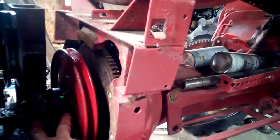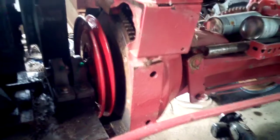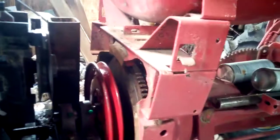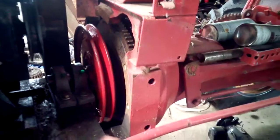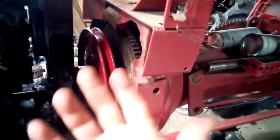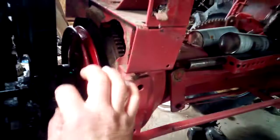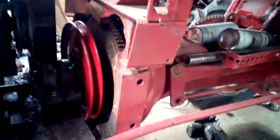Of course, two pillow block bearings, custom machined hub, so the flywheel sits on it, and then it has a shaft, so it still allows the pilot bearing and the clutch and everything to mount. The only thing that's really had to be machined is basically that hub that allows the flywheel to kind of cup around it like it would on the crankshaft of the other engine, and bolts on with 4 bolts with a shoulder in it for just a little more support.